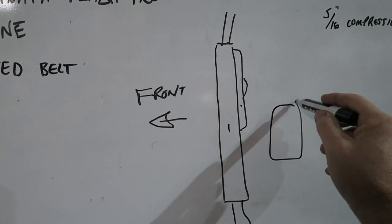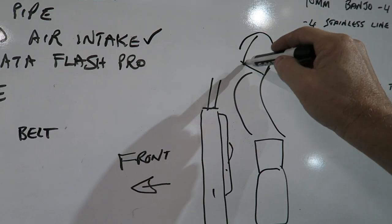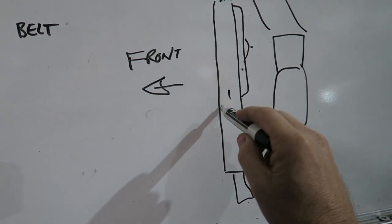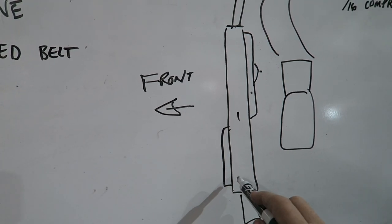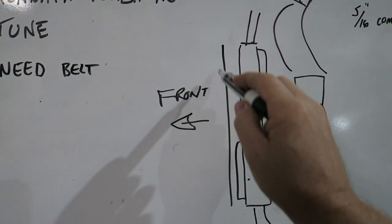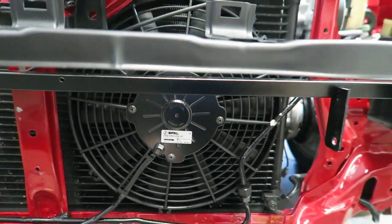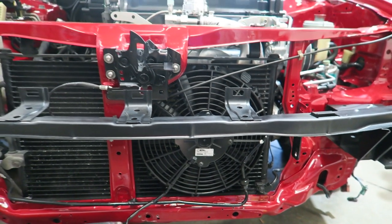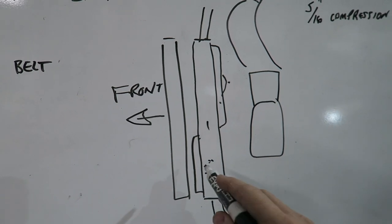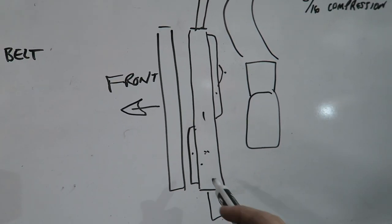This is our radiator setup. We have a turbo here, the intake is gonna go something like that with a real cool filter. This is the hottest part here, so we're gonna put a pull fan on this side of the radiator. We're gonna put a push fan, and it's gonna go between the condenser and the intercooler will go here. Now it's important to have strong fans. The eBay fans look like a fan and make a noise — they're not a very good fan. The only fan I use is Spal — much much stronger fan.